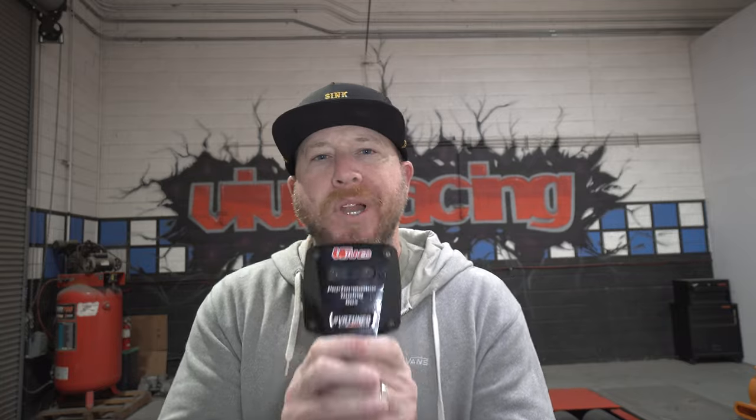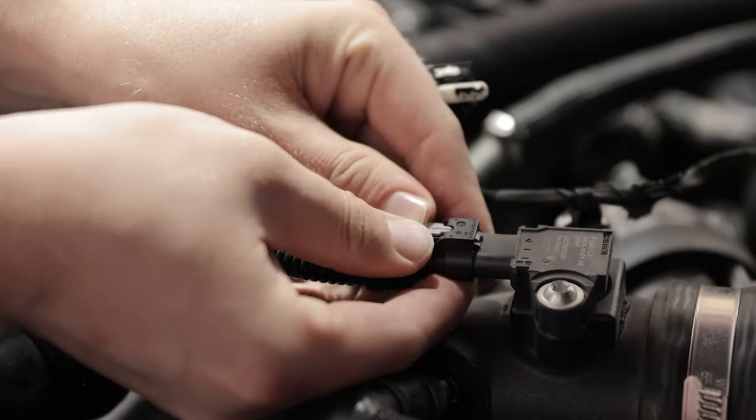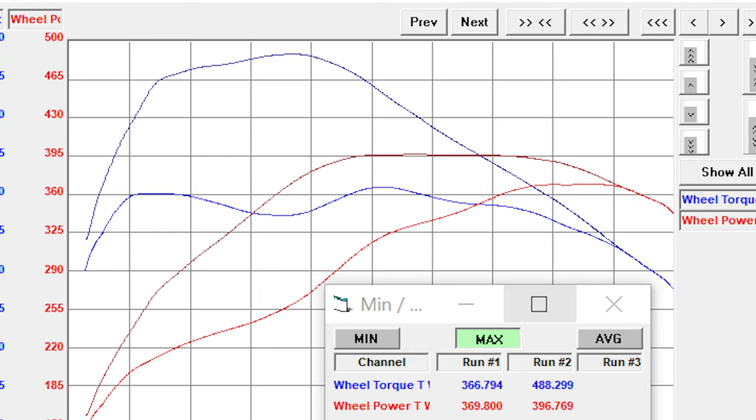So what is a tuning box? The VR Tuned Tuning Box is a device that plugs into your vehicle in between engine sensors — specifically for turbocharged cars, the boost and manifold pressure sensor. This device has high tech computer chip components that change the signals going to your boost and manifold pressure, delivering more boost pressure to a safe limit and having your ECU automatically adjust fuel and timing accordingly. That helps deliver some serious extra power.